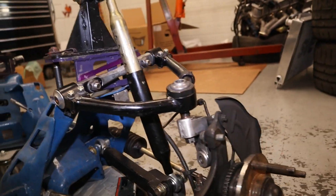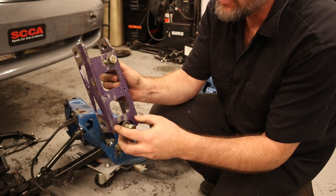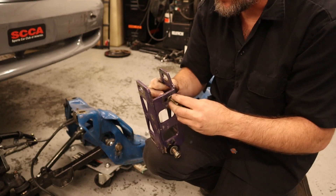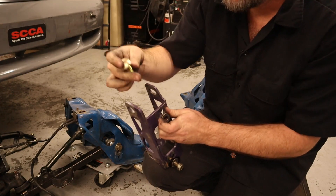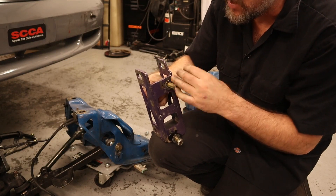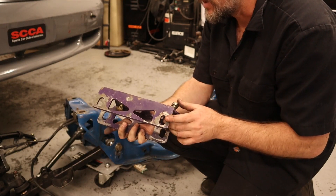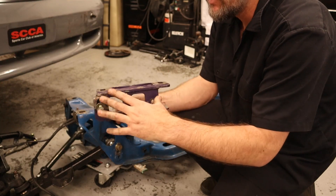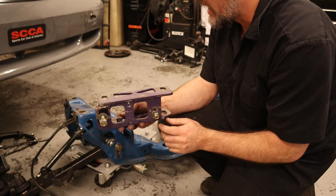Here is the upper bracket — you can see the square holes and the carriage bolts. These are pretty sweet: the square section locks into the hole so they can't rotate. The only problem is I'd have to take the bracket all the way out to move to a different hole, but I'm not really changing those holes. Also, not just for anti-dive — moving this upper arm up and down can change my roll center, which was one reason I had that adjustment in there. Same with the K-member: moving those holes up and down changes the roll center, making it easy to raise or lower it depending on what we're trying to achieve or the ride height we're at.